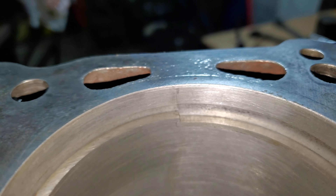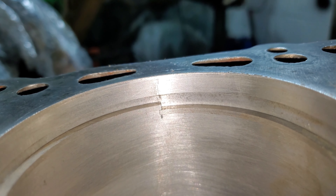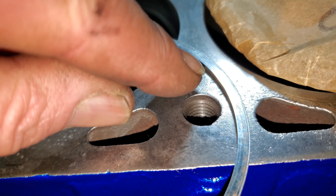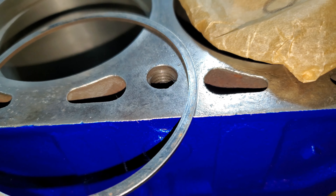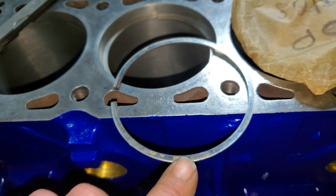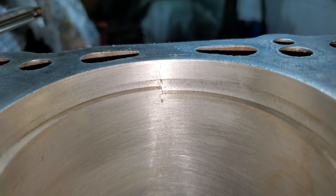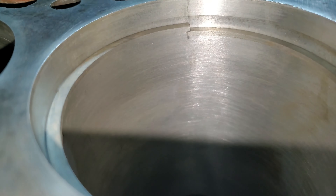As mentioned in the last video, I had some piston rings stashed away - these are new standard rings for the two-litre out of many years. First time I've actually really looked at them properly. I decided to measure the ring gap of a used ring that's not exactly tight, and that's one millimetre, which is way too big. We knew this build was never going to be perfect, and those standard rings are not standard - they actually overlap.